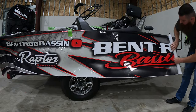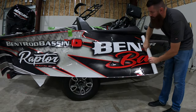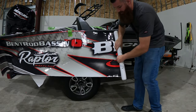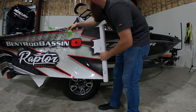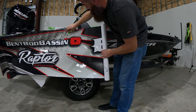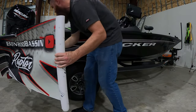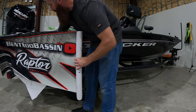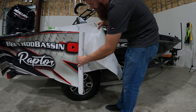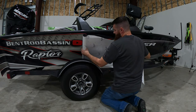Kind of get it out of that wheel well a little bit. Like I said, if you can take off your fender wells, take them off — anything to make this process a little bit flatter is going to make it a little bit easier. Get the tape off — I'm just going to keep going. Once I'm able to get the backer paper, I'm just going to hold the core and pull the backer paper with your opposite hand and kind of work it in here.